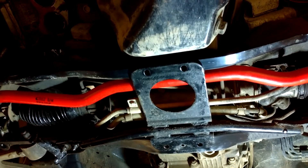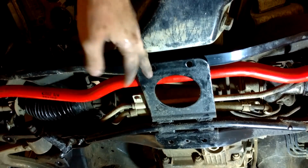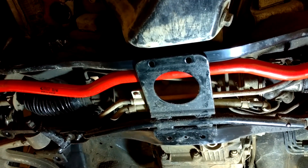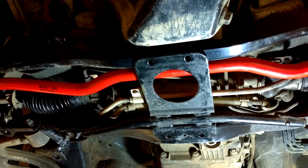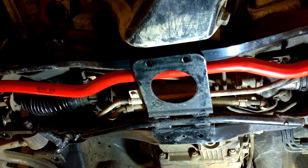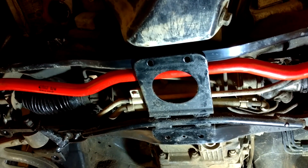The sway bar is in. One thing I forgot to mention: you've got to take a tire off to be able to pull the sway bar all the way out. I ended up taking this piece off instead because I'm too lazy to take the tire off. With the end links, if you watched that video, you've got spacers in there — I took out one of the spacers on the lower end. Put it back on the ground, tighten everything up, and then check your fittings at your end links. You should be good to go.